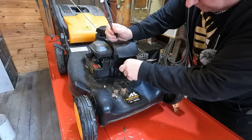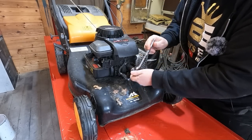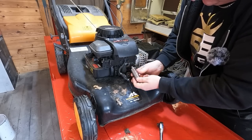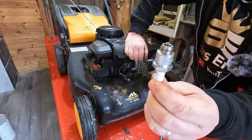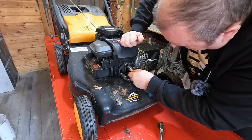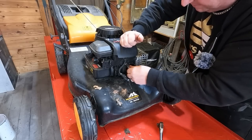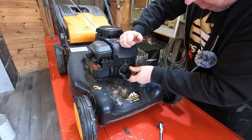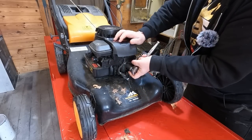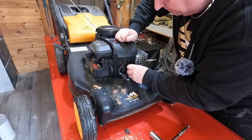I like to just take the spark plug out and have a look, just to see if there's any possible issues with running or whatever. It looks like a pretty new plug and it doesn't look like it's done any work at all. You can still see the threads and all that are spotless. Can't smell any fuel on it. Looking in there, there's a little bit of carbon build-up but you'd expect that anyway. It looks like someone might have had this and it packed up and they've probably done a little bit of work on it to try and get it running. That ring hadn't been compressed either - so that must have obviously been a brand new plug, a B2LM, which is correct.